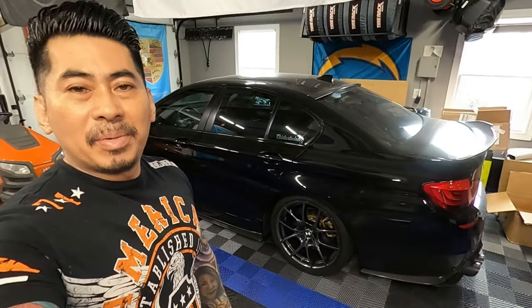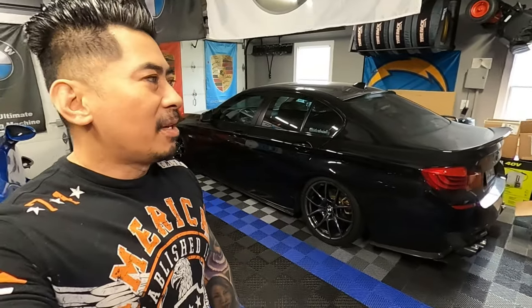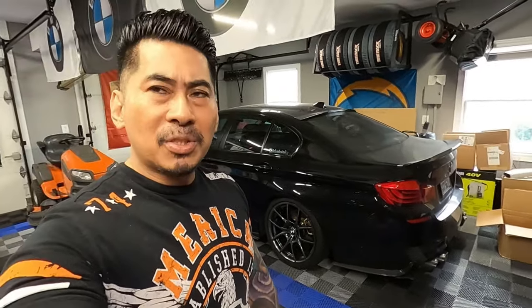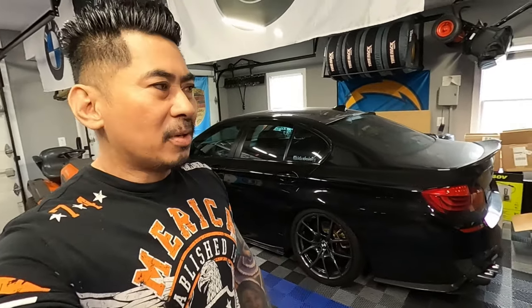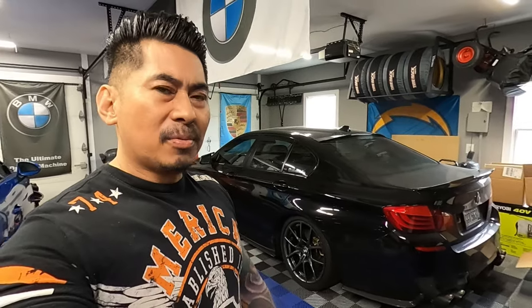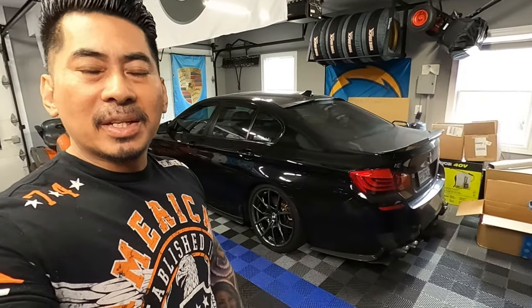Also guys, my BMW's thermostat decided to take a crap. Every time I'm driving, the fan just kicks on after about 15 minutes. Not like I was driving hard or anything, but I noticed it kept kicking on, shutting off, kicking on, shutting off. It's really abnormal. Then I found out it sounds like the thermostat is the culprit.